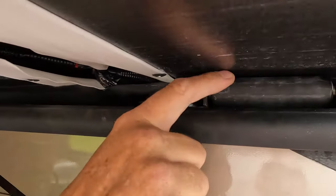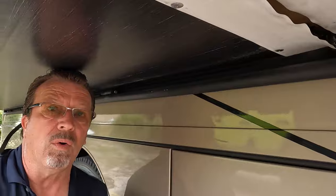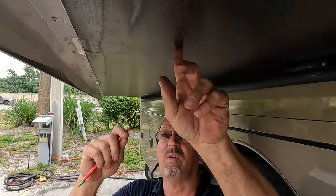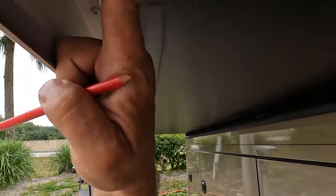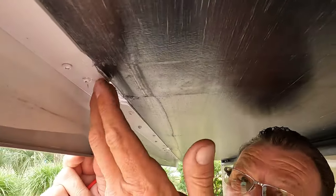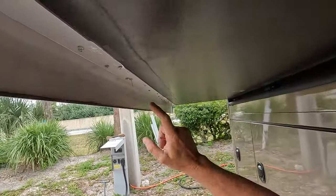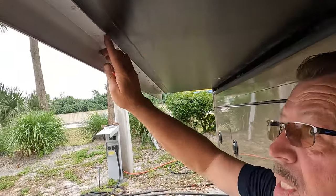This slide out has a roller that doesn't carry any weight — we open it and that thing's not even rolling. So the whole slide out has the weight on one end, and what happened is the second roller is now gouging into the floor. You can see that indent. The weight that roller isn't carrying shifts to the next one, and the next. I'd at least have the front roller adjusted so it carries the weight evenly.